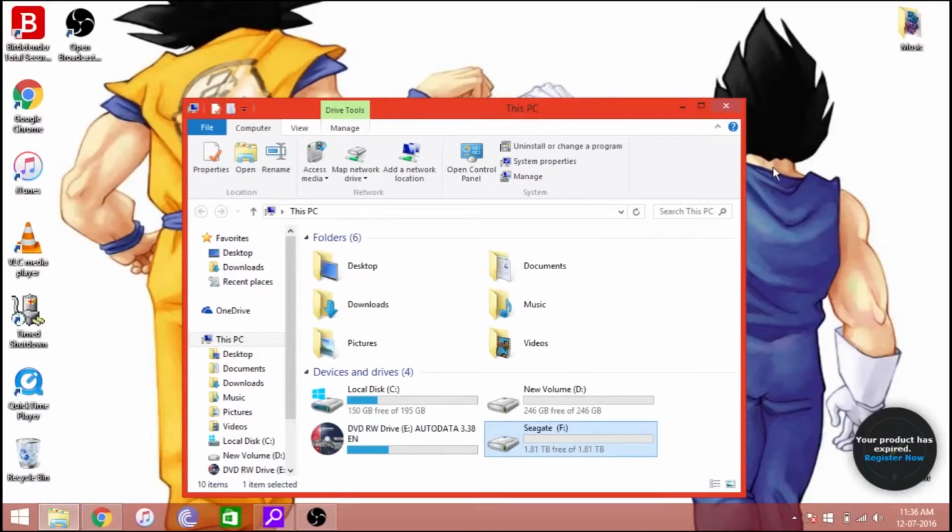The reason you may have a format that you might be able to change it to is basically FAT or FAT32, one of them, and it has its limitations in that you can't put any individual file bigger than 4 gig on it, whereas with exFAT you can put anything above 4 gig, anything under 4 gig, so it's a lot more user friendly, I would say.